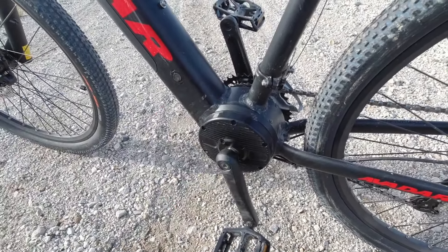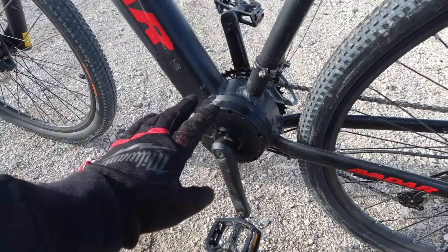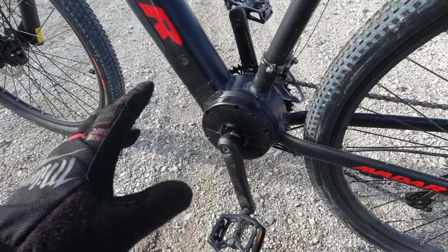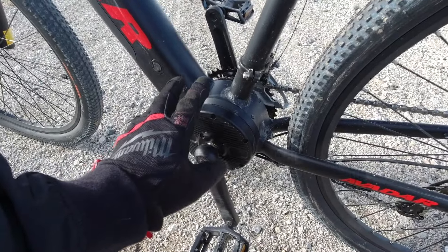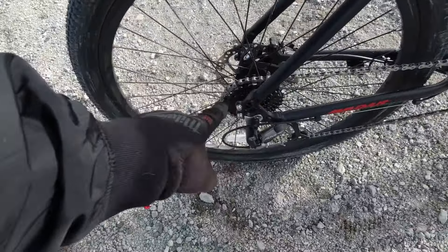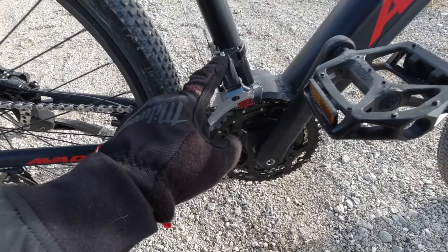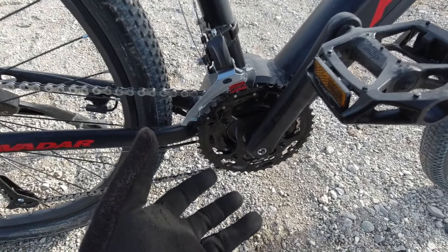It's a 250-watt motor, which has its pros and cons. 250 watts is smaller and less powerful, but it's a world motor — accepted in the US and all over Europe, which is probably one reason they went with it. When you have a smaller motor you can compensate by amplifying power through gearing. They provide a large chainring and a smaller chainring, giving you flatland speed with the big one and hill climbing with the smaller one — technology that goes back 50 years, applied smartly here.